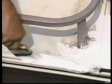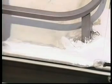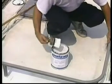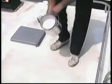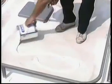Coating small areas or the entire roof is simple and easy. Use a brush on the edges and around openings, seams, and edge seals. A brush is also handy to work liquid roof in the crevices and prevent pockets. To coat flat or low slope surfaces, simply pour liquid roof right on. Use a squeegee to distribute the coating and smooth it with a short nap roller.